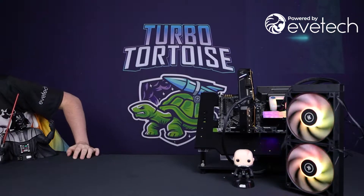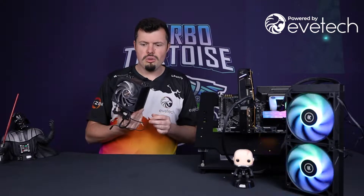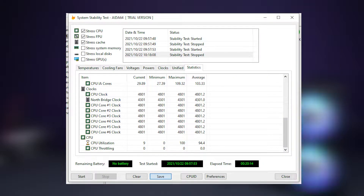To test this I'm putting it up against my Hyper 212 Black Edition, which is normally on the test bench — if you've watched the channel you've seen this guy. Normally I run the 9600KF at stock clocks so I don't get extra temperature headroom and don't blow the doors off what's basically a 10-year-old tower cooler design. But today we wanted to push it to the limit, so I overclocked it to 4.8GHz, which brings it close to 80°C and its throttling point on that cooler.